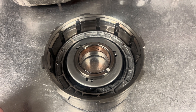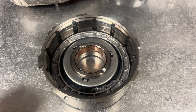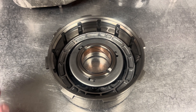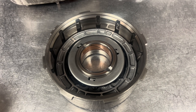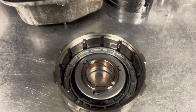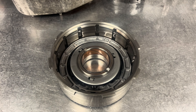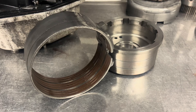Something to note on the direct drum: I get a lot of people calling and saying they want to stick a full manual valve body into a currently full-functioning transmission. One reason I say that's a bad idea is that on my builds, you definitely want to run 12 return springs in the direct drum with a full manual valve body. With a full-functioning valve body you typically run nine. To change from nine to twelve, you've got to take the whole transmission apart, press this drum apart, and add three more springs. I'll also show you another important reason further into the transmission case.